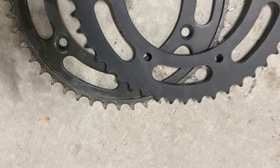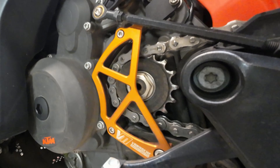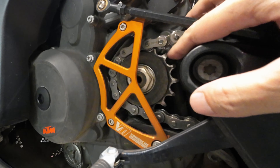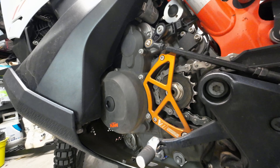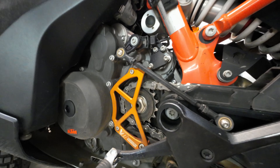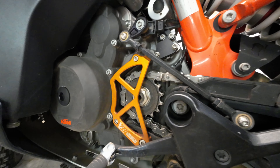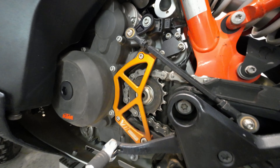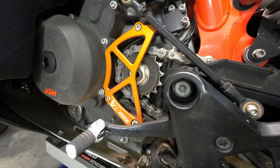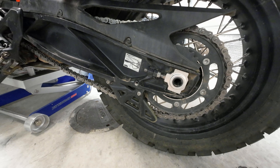It's like you just adjusted it and it continues to stretch. You get these kinks in it — how it's not pulled straight, they bind up. I don't know if you can see that. They get bound up, you see them in different spots. It just doesn't lay flat and smooth. It gets kind of stuck and it'll start stretching, getting hard to keep tight, and you keep adjusting on it. That's when the chain's going out.